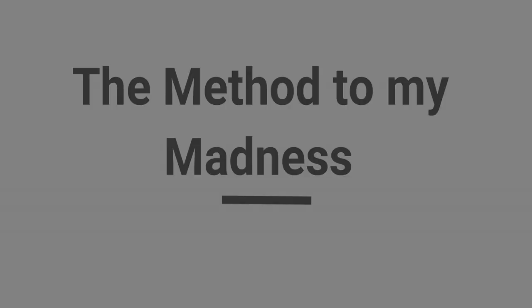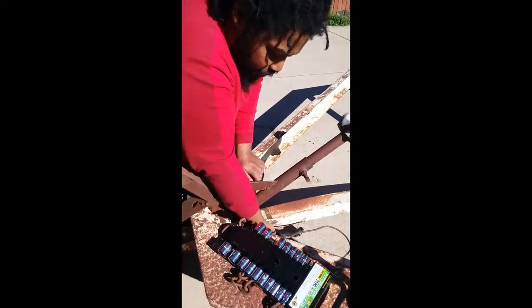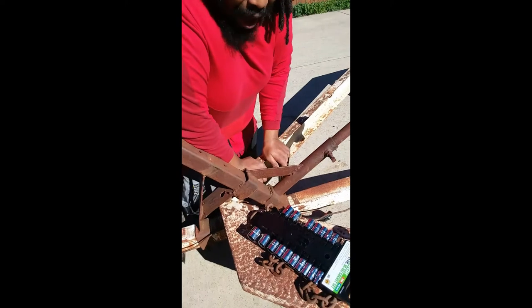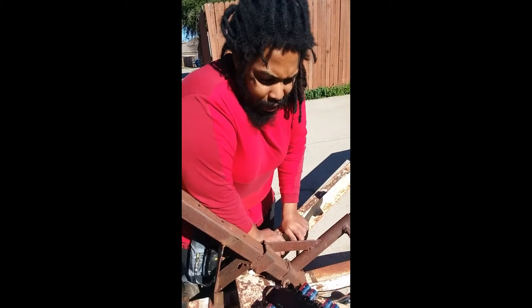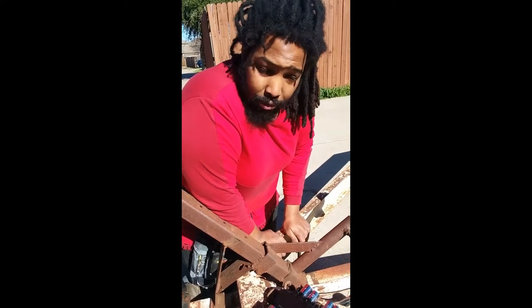In this next scene I'm going to start by explaining how I'm taking this trailer apart and how I'm going to retrofit it to be ready for a house. I'm starting at the bow — the front of the boat where the bow roller was. We took a second to get our tool adjusted onto this bolt, and it turns out they are not metric, they are standard — on a quarter-inch basis. The one we found it to be is 11/16, which translates to roughly 17mm.